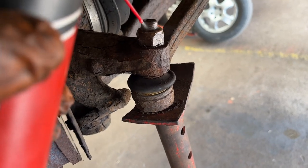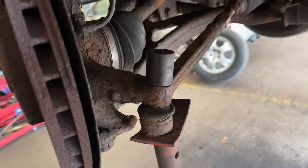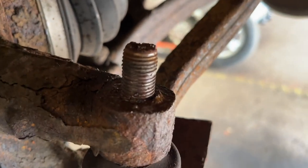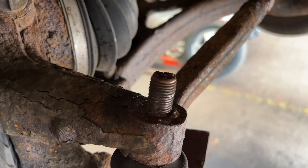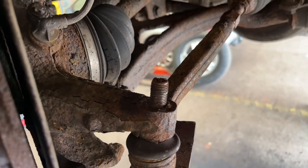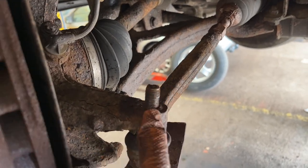I've been leaving that to soak. I've put the socket back on — it's a 22mm, same size as the tie rod. I'll get the gun on it and see if it comes loose. I've got the high-torque Milwaukee on there. There we go — that's it off. Now, as I mentioned, this has been on for seven years and 30,000 miles, and it's come off like it's brand new. This is proof of what we do: copper grease on the threads, coat with wax oil — that's exactly why it still looks as good as new.